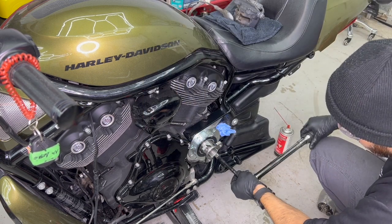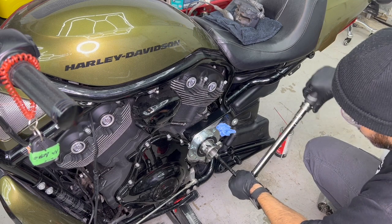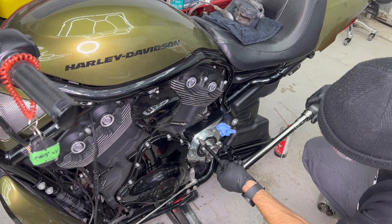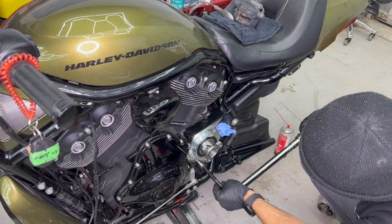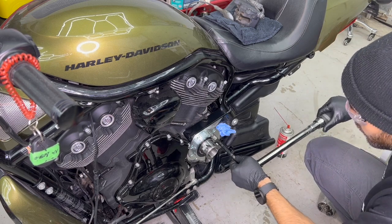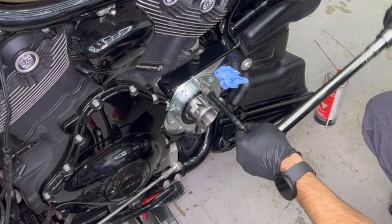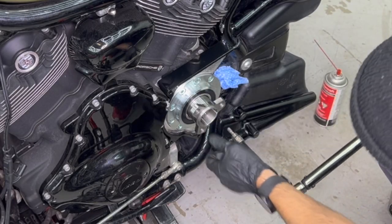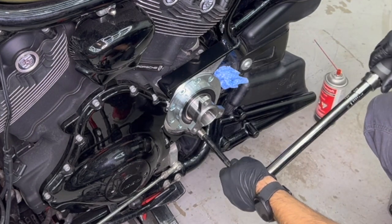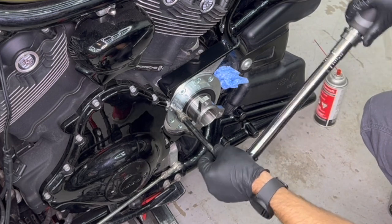Now you can go ahead and tighten your surrounding bolts and make sure that you use the red Loctite and that you torque them to 25 pound-feet. Guys, just please take note that when you're screwing bolts in and you're torquing, always go in a diagonal way, which means that you tighten the bolt on the opposite side.